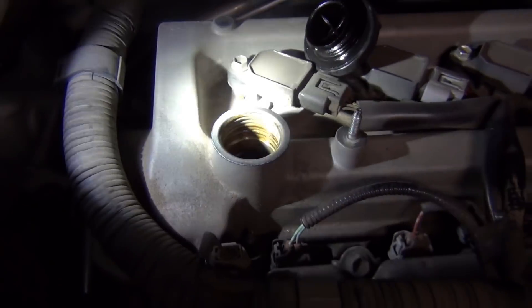So the way I usually approach a noise like this is I do steps. The first thing I do — and it works most of the time — I call it the cobra. You ever see a cobra? They move their head side to side and they use their pits to sense heat to strike. When you move side to side, it's almost like depth perception — the distance between your ears and the noise, you can kind of triangulate it. Your brain just does that on its own. If that doesn't work, I get out a stethoscope — a special stethoscope for cars. I put it on the sides of the injectors because they were suspect, on the alternator casing, on the oil valve for the timing. I just try different points on the motor and try to isolate it down to individual components.